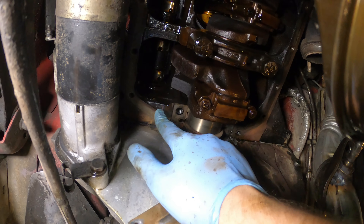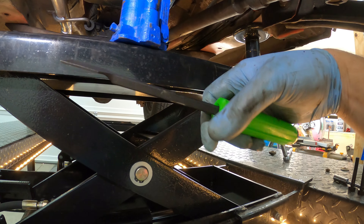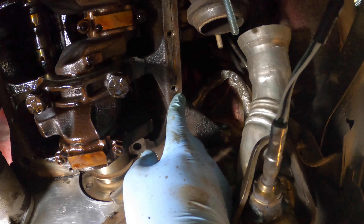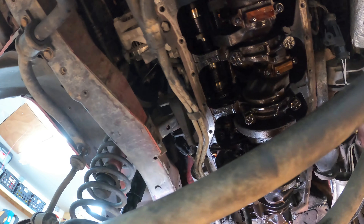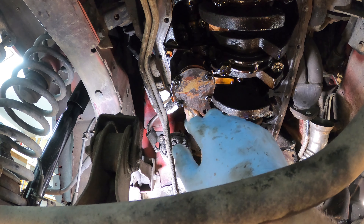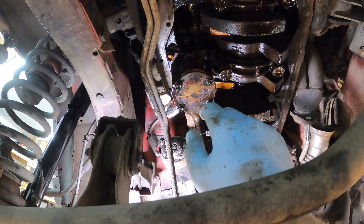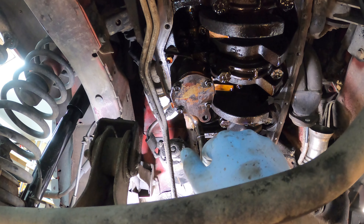We are still into the Jeep. I just cleaned up all the gasket mating area all the way around. I use these scrapers from OEM Tools - comes in a three pack with a few different sizes. The goal isn't to make it shiny, it's to make it flat and smooth just so that your new gasket has something clean and clear to mate to. There's definitely a lot of yucky buildup - this is all just oil gunk. It's 27 years old with 260,000 miles. I'm probably going to run some seafoam through it, put fresh oil in, let it run a couple hundred miles, dump the oil, refill, and do that three or four times using cheap oil to clean up the buildup.